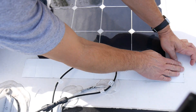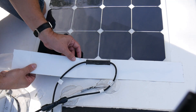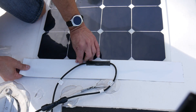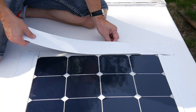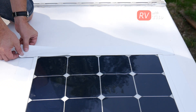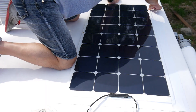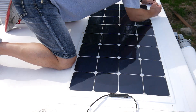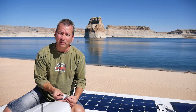Once I had all the sections of tape cut, it was time to start sticking it down to the roof and the solar panel. I started with the back piece of tape facing the rear of the RV where the junction box was. To apply the tape, peel off just the first couple inches at one end, get that stuck down, then slowly remove the sticky back all the way to the end, keeping the tape lined up as you go. Then apply pressure and work out all the air bubbles to make sure it's solid and stuck really well.